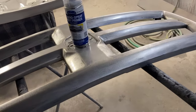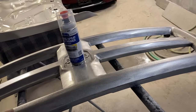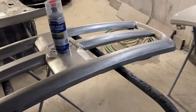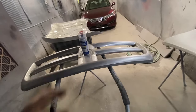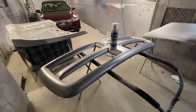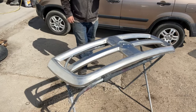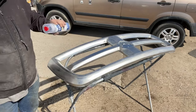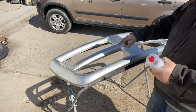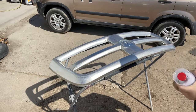Chrome is metal, so there are parts of metal to it. Once you scuff it down, I always like to do a top coat and then flip the grill upside down and do one from the back, so it covers all the way around and gets nice coverage. This thing is pretty much ready to go. Now we're gonna shake it and start applying the primer — I'm gonna do a lot of coverage on the edges first, because that's the areas you want most coverage on.